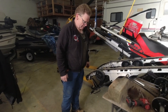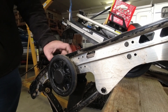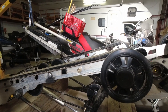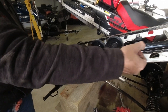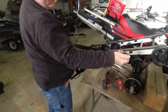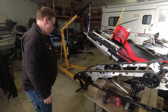We've got the slide cage up on the work table here and you can really see this waviness. Not much wear at the front - all the wear is right here, and the rest is pretty consistent all the way along, except at the absolute back end where it's protected by the wheel. This is the new one - consistent about a quarter inch, maybe a little better to that wear bar, all the way along. These are genuine BRP slides from the local Skidoo dealer. I like using genuine parts whenever possible.